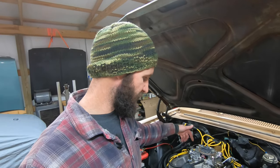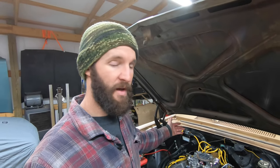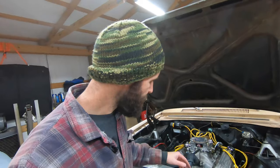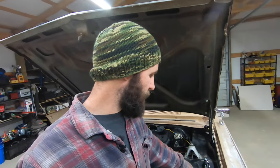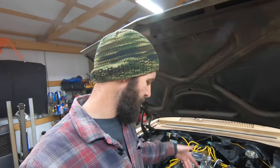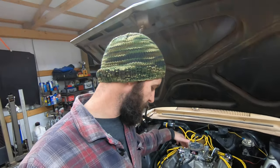You can tell on the surfaces of that over the years of how whatever motor it may have originally come from and the service that it's given. So a thin coat of the Ultra Black on both surfaces to fill those little imperfections, clamp that all down, and reseal the bolts, and that's all good to go.